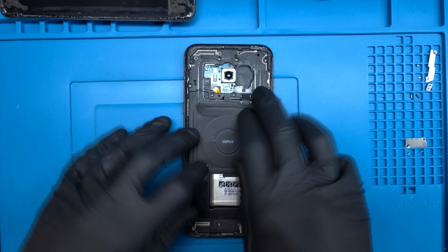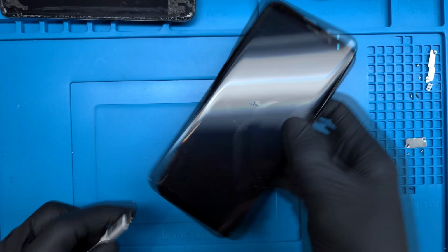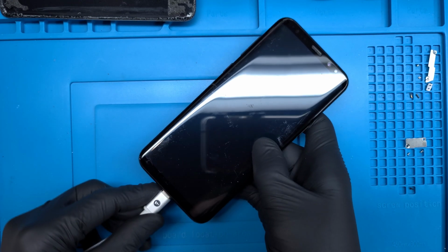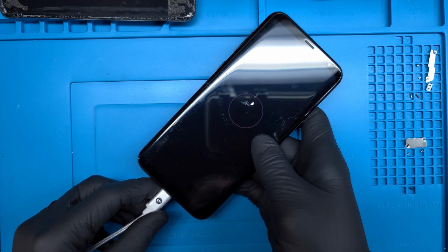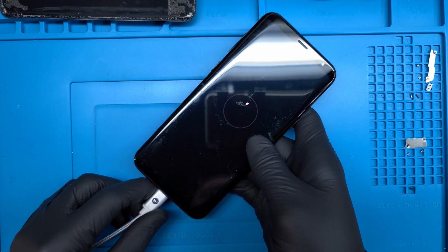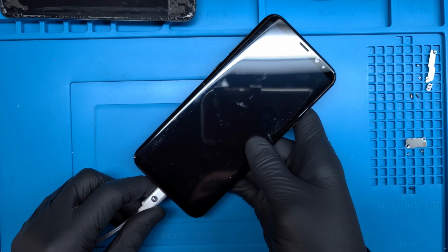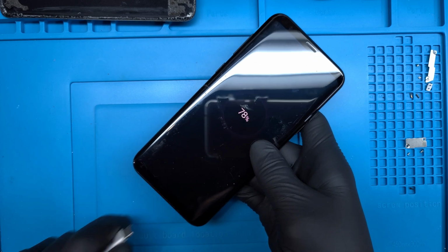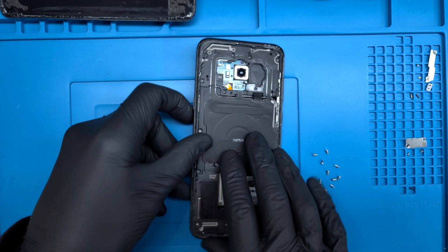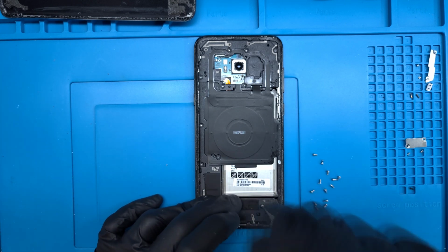The wireless charging coil also contains a temperature sensing resistor that will stop the battery from charging if the temperature is too high or low, but without it the phone assumes it's too hot. This sensor would have been more useful near the charging port or battery connector, but it isn't very close to either. I'll connect my new not yet melted USB-C charger to the port and ensure it charges correctly without going supernova. With everything looking good, it's time to tighten the 15 screws holding the midframe in place and get the device reassembled.